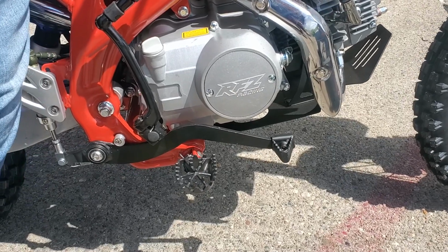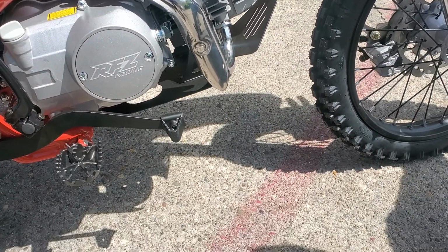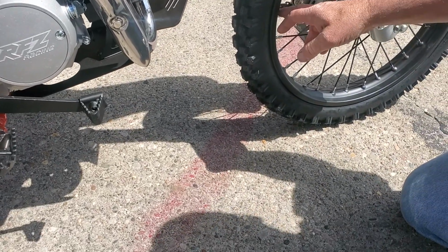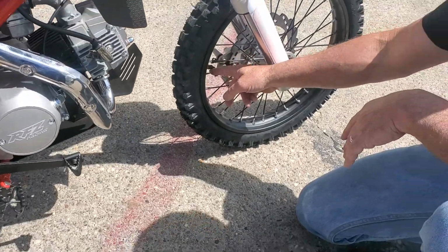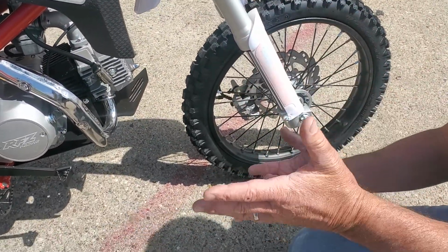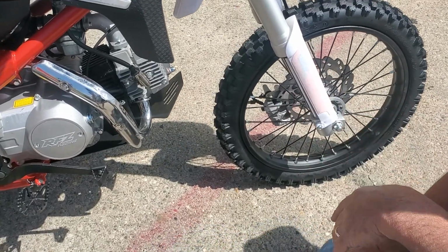Okay. And make sure you check your tire pressure. Because they've got the inner tube in it, and the tube part that you put the air in is metal, if it gets too low, it'll literally cut itself. So it's 25, 30 pounds of pressure. 25 to 30, okay. Right now they're set at 30, so that's a good pressure to keep them at.